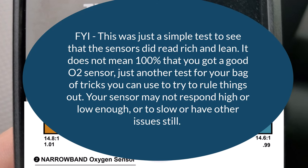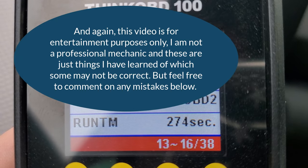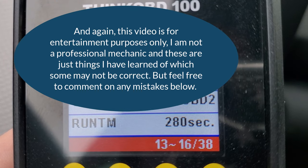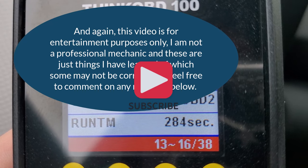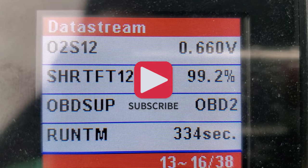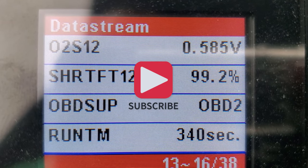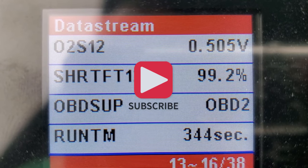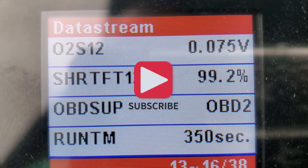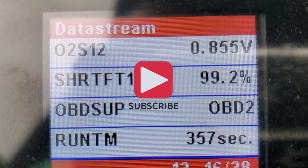You don't need a graphing scanner — you can do all this without one. That's going to wrap up this video. Sorry it took so long on oxygen sensors, but I thought it was important to go into them in a bit more depth. You can see from voltage readings what type of sensor you have — if you see 3.3 volts, that's probably a wideband sensor since narrowband doesn't go above one volt. It's useful to understand that and see how it reacts. Hope I described it well enough — hit me up in the comments if not, and I'm always looking for ways to improve.